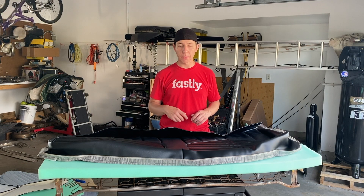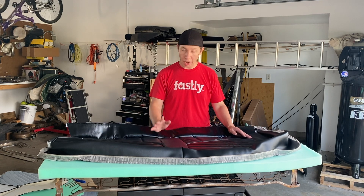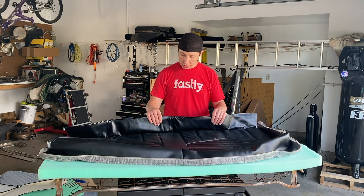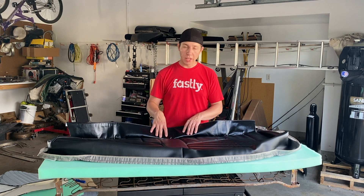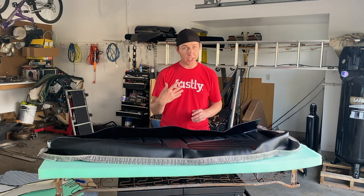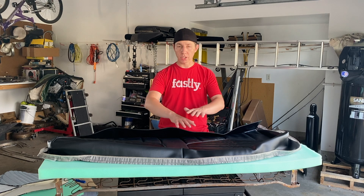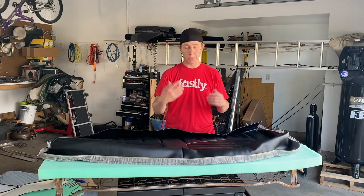Now that we have the rear seat cover out, we can take a look. The material is actually really, really nice — I really like how it looks and feels, and there's no bad stitching that I can see so far. The first thing we need to do is probably just hog ring the back here, see how much we can stretch over front, and see if we actually need to trim the front or sides. From what I've seen online, it's mostly just hog ring the back, stretch up front, and stretch to the side to get it over everything.